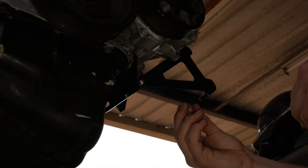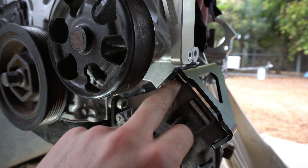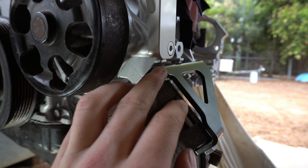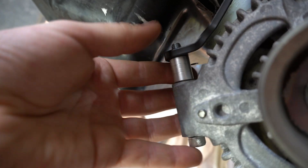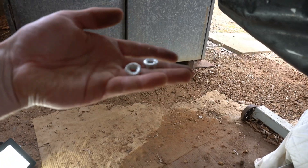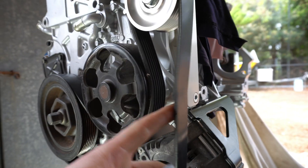What I've realized is you're actually going to need spacers in between here just to get the alternator to sit on there properly. Fitting the alternator, I've used the longest bolt and the next smaller spacer — I had to file it down just a little bit to get it to fit, I think when they painted these they didn't allow for that tolerance, but that's the only downside so far. For the bottom bolts you need the biggest washer, the allen key head bolt, and two flange nuts on the bottom. As of right now I can't put the new coupler on as it's a smaller size than the original, so I've left the belt loose and will do that another time.